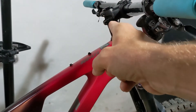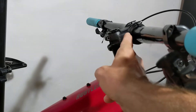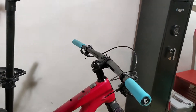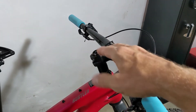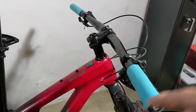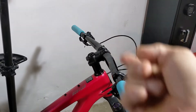If you add a bunch of spacers thinking that's raising your handlebars into a better position, you're actually bringing the handlebars closer to you, which isn't necessarily ideal because then you shorten your cockpit. What you want to do is get taller bars if you want the front end of your bike to be higher. This bike came with all these spacers and I don't like it. I want my bars and my stem to be a little bit further forward. By raising the bars, those bars are going to be roughly in the same position as these, but it's going to look a lot cooler. Let's go ahead and get to swapping them out.